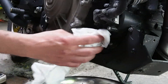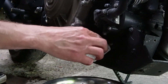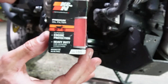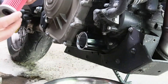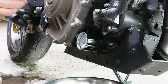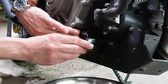Make sure you wipe down the housing and the flange itself, as oil residue could potentially create a leak or prevent the gasket from seating properly. Do the same for the actual cover. The filter we're using is a K&N KN155, which is the K&N version of the factory oil filter. When installing it, it's super important that you put the gasket side forward — you'll feel a little pop when it's physically seated.